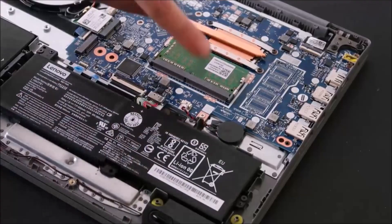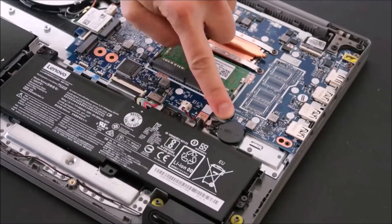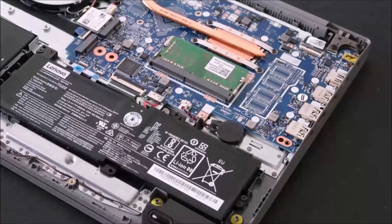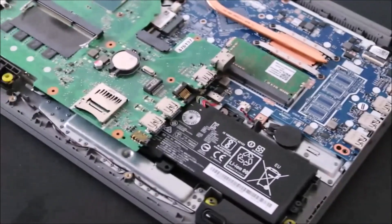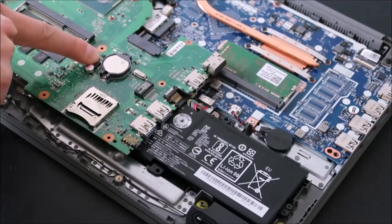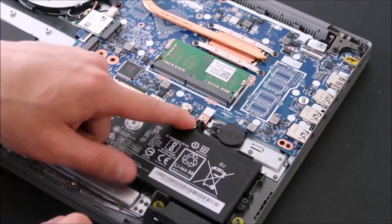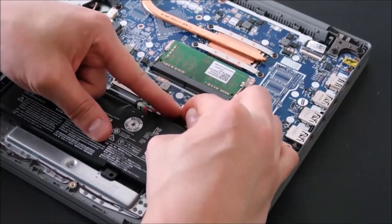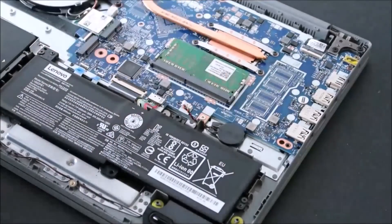The third and last test in this video is how to perform a manual BIOS reset on your computer by temporarily removing your CMOS battery from your motherboard. This is your CMOS battery — it's a little round component that looks like a watch battery inside. It's wrapped in black electrical tape and it plugs into a port. Another common CMOS battery presentation is on a motherboard where it sits in a holder. All you would do is unplug it from the port — don't pull on the wire. Just put your fingernails on either side and slide it out a little at a time, wiggling it out until it's unplugged.